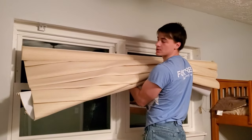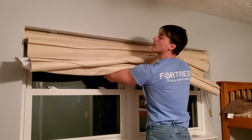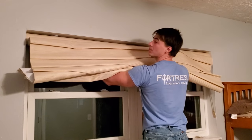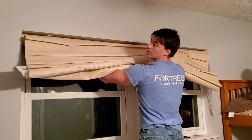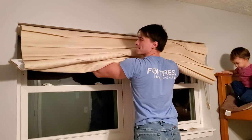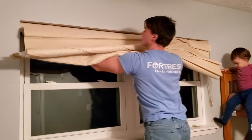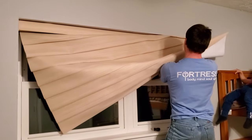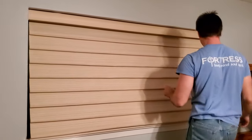The way that this works is you have to put the back corner in first. Back corner in, all the way tight to the top of the bracket. Push it in, and then bring the corner closest to you up until you hear a snap. Just press up. There we go, that's one side. Push the mirror. Other side, it's up. Now let's try if it works.